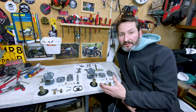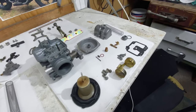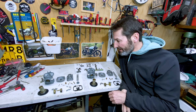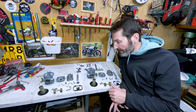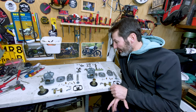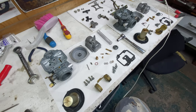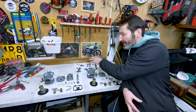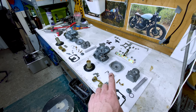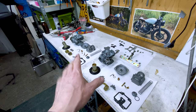This is everything cleaned out now, using the machine that Dennis was kind enough to lend me. They came out really nice. I do think that if you use something different like the proper cleaning fluid, it may come out a bit cleaner. I had to do it twice for certain bits, but they were really dirty so that's still worth it. The special cleaning stuff is really expensive, but the regular cleaner — dusty — is really cheap and it seems to do the trick pretty well. It's worth having a go. I'm going to reassemble everything now. These are the two carbs separated with all the different pieces. I used compressed air to blow out all the little holes everywhere and blow out the last pieces of water and cleaning fluid.